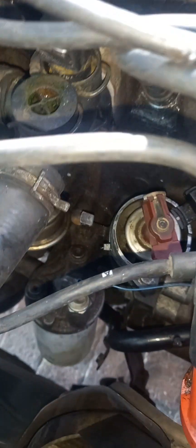Come over here to your rotor. Your rotor must be facing number one. There's also another line on that side — that must be in line, and the rotor must be facing number one.